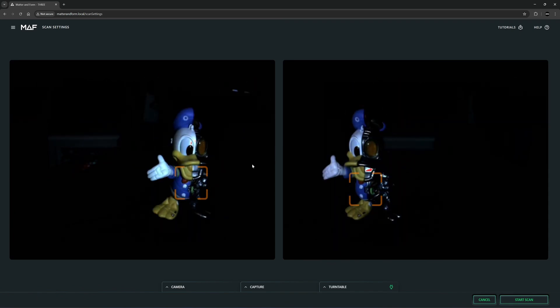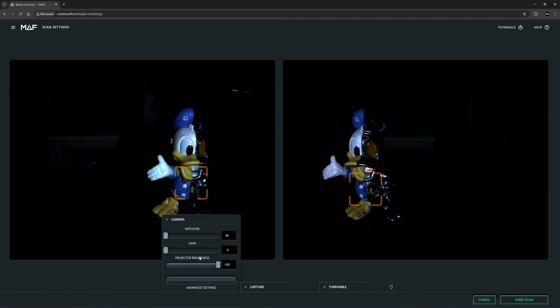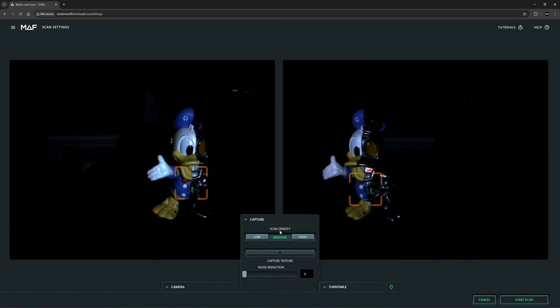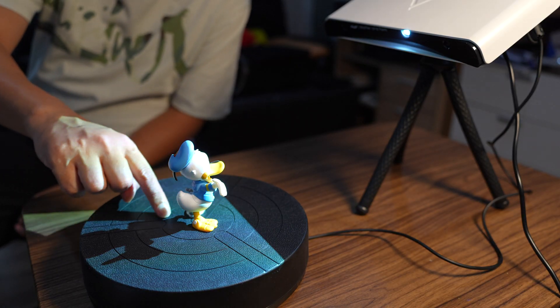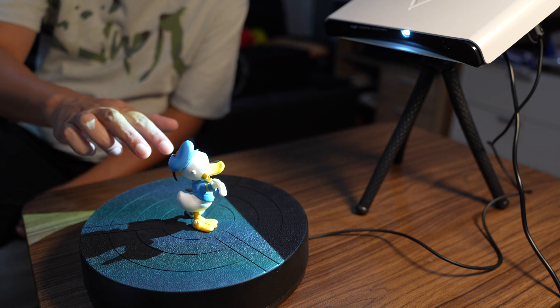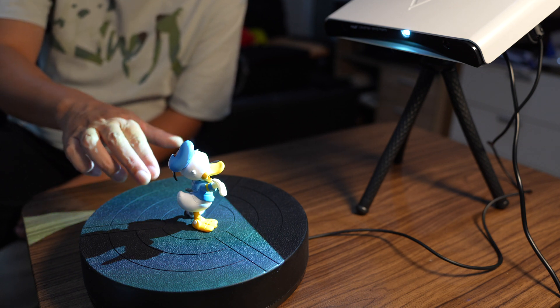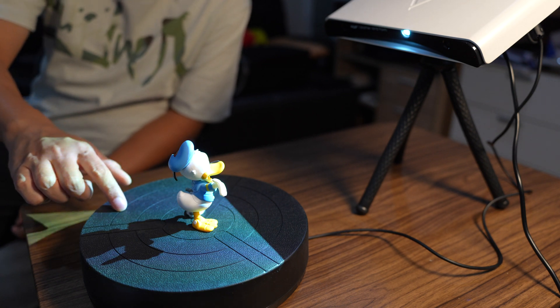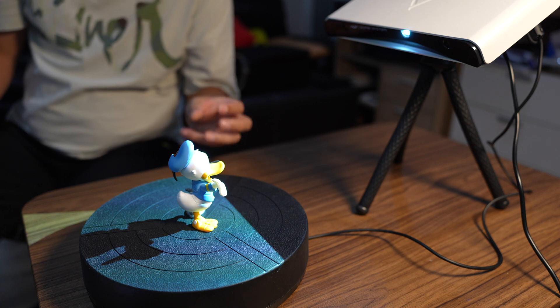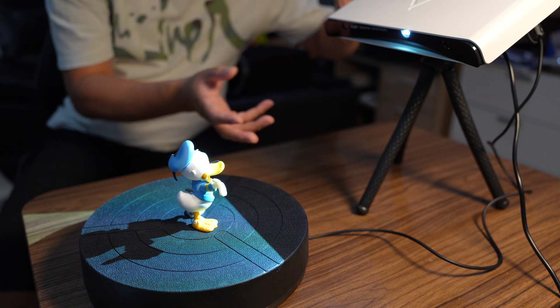Let's try the test chart and see how much the scanner can capture. In the camera settings, adjust the exposure. In the capture menu there's scan density — medium and high. High will give you higher definition if the object is small — meaning it fits within the inner circle of the turntable. If the object is a bit larger, in the second or third circle, you should use the medium setting because the scanner has to be backed off and you won't get the highest resolution anyway.